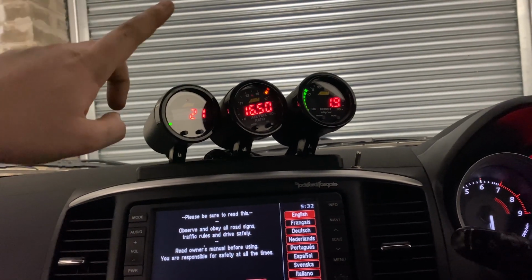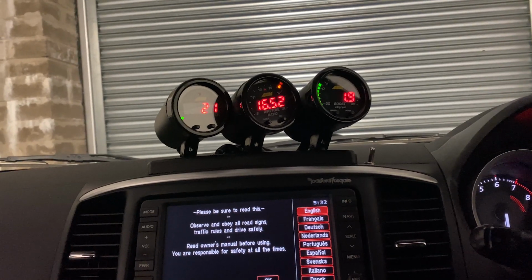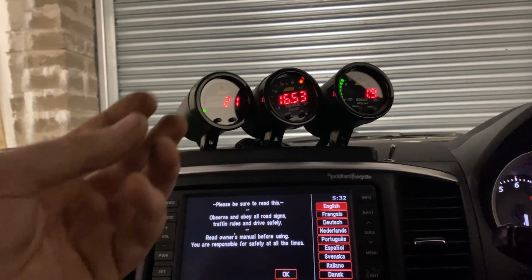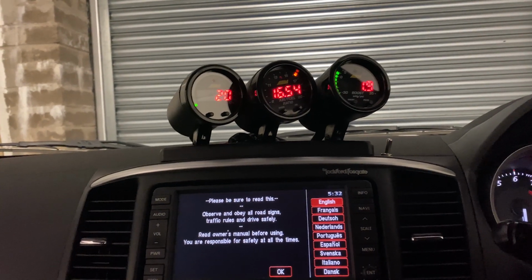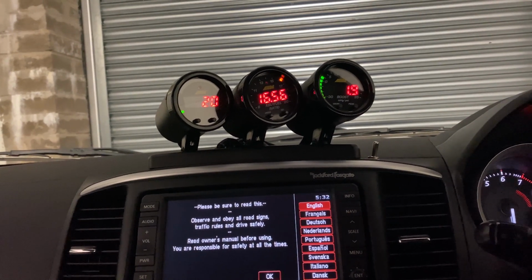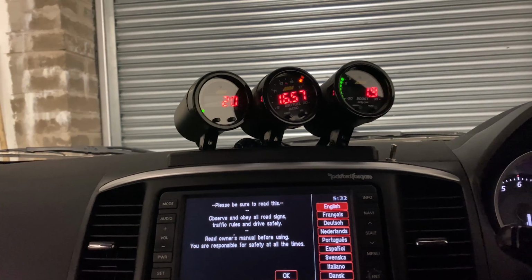I bought this once and hopefully it's just going to work for the life of the car. So that's why I've gone with this. I'm not knocking people who use the tablets. You do what you want to do. Their argument would be they don't want to have the sensor on the bottom of the car because it's another thing that could potentially be hit off and all your fluid could leak out. But from what we saw from my install, it shouldn't be the lowest point. And if it does get hit for any reason, there's a very flimsy plastic connector that's just going to snap off well before that brass gets ripped out of the gearbox.